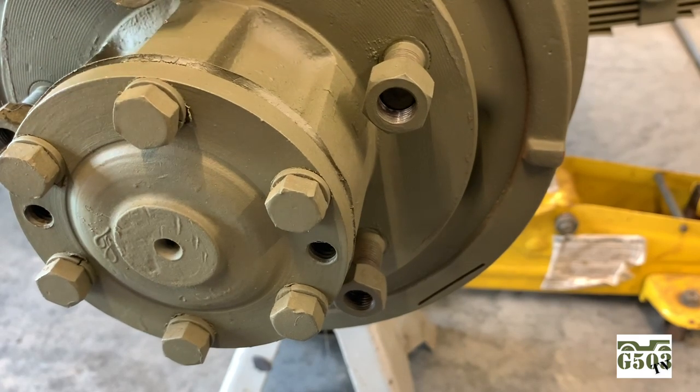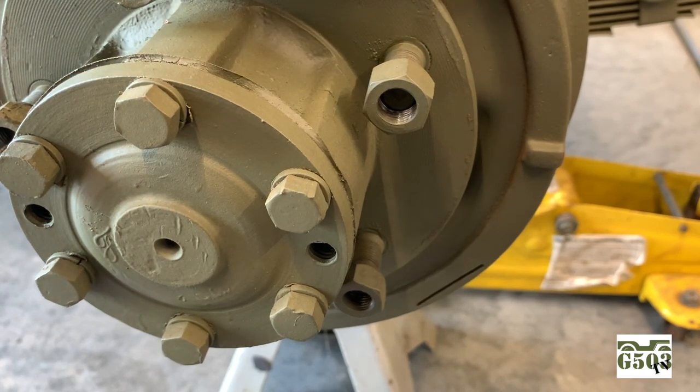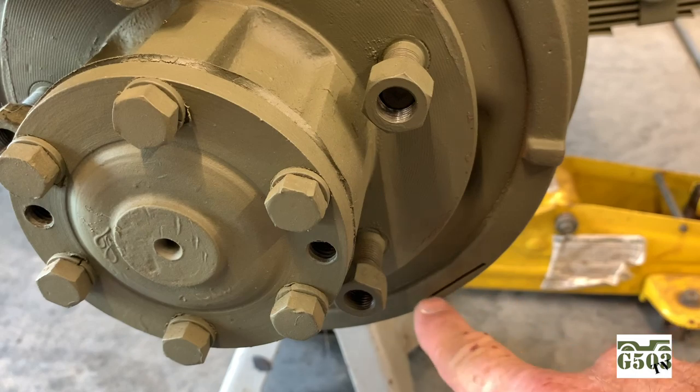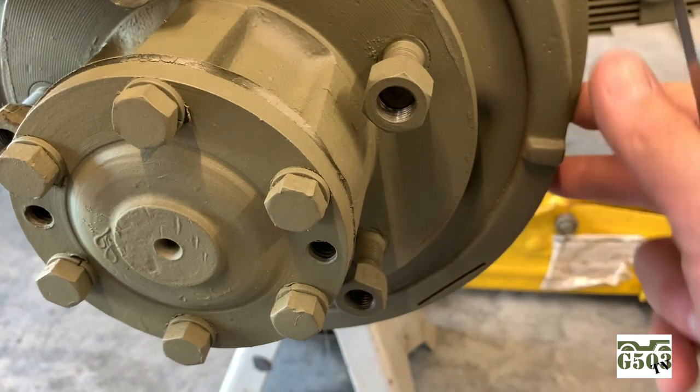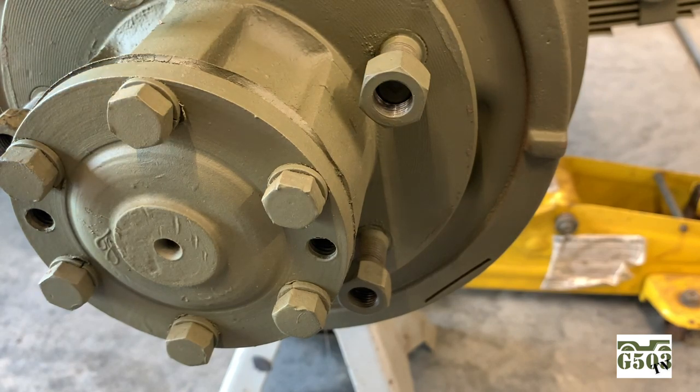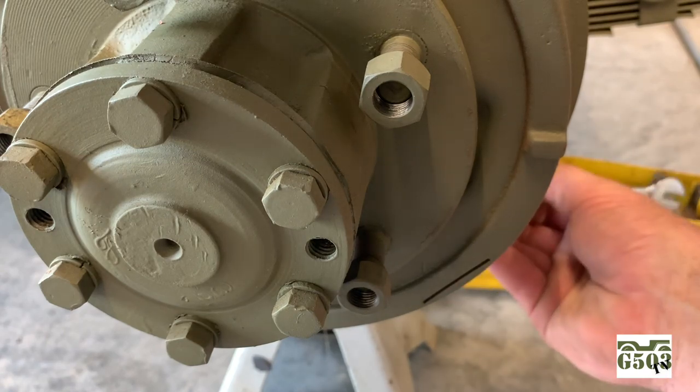We'll shoot this side, the rear side of the anchor pin, from the outside so you can see exactly where I'm going with that slot and the feeler gauge. Basically, I've got a line up there. Use the flashlight again so I could see the end. Remember, these pads are shorter here, and you want to be about an inch in on the pad from what the manual says. And you're going to take your wrench. It's just a good place to start.